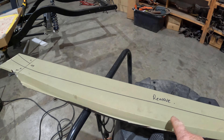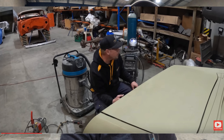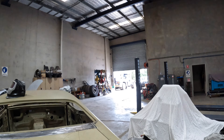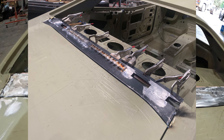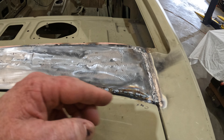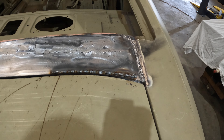As it turned out, this part of the panel — right next to the boot — ended up being about 10mm lower than the boot lid. Originally there was a bit of a rush to get this thing over to the engineers and get the torsion beam test done. Any of you that watched that video would know it started out trying to get this boot to fit, and it never really fitted properly — we ended up just having it fitted so we could take the car over complete. So apart from fitting that panel, I've already added the extra 25mm in, and I've been working around it. You can see some MIG welding here — I ended up splitting that seam and moving that piece a little bit in because it was just too tight. I'm going for about a 5 to 6mm gap.